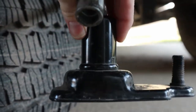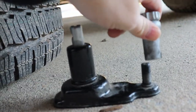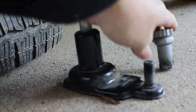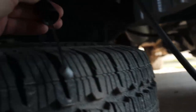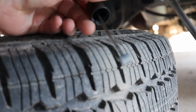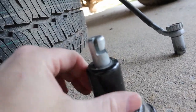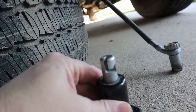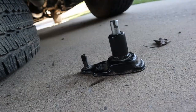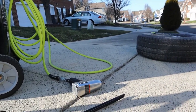This will be on the underside of the rim, holding it tight against the chassis. This tether here just screws onto the bolt — to remove it, just twist the top and remove it like that. This is the cable that actually ratchets up and down. Screw off this black cap and there's a little bicycle ferrule there — that ferrule snakes inside and locks the piece on, so you can remove it. This stuff is all in your owner's manual but hopefully this will be a little bit clearer as to what to actually do to remove your spare.